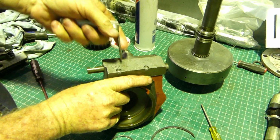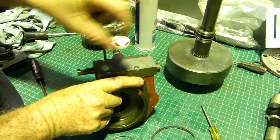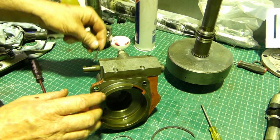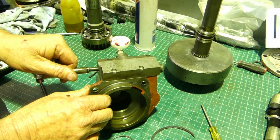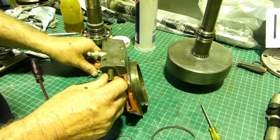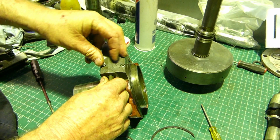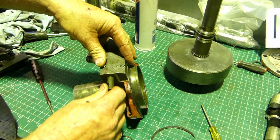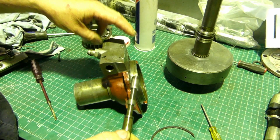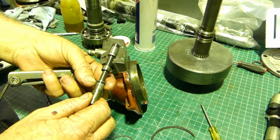Maybe only half doing it, not showing you this. But it seems to be working well. And if you can pop yours apart and you can push that back and forth and air test it, and it's doing the right thing, oh, that's something. This one here, you see the oil on it, that stops your valve going too far. When you pop him out, there's your spool. There's a little O-ring there. Look, I suppose we'll replace that.